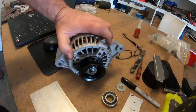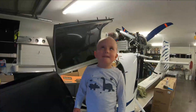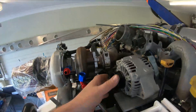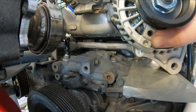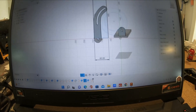We're going to build this alternator — 70 amp — going to mount it to the engine just like this. That's not how you do it — whoa, pull it back. Okay, so this is a Denso type alternator going onto this plate here. I'm going to mount the plate, which I've mounted to the engine. This hole here is the lower bolt hole for the adjuster, and that's the top hole for the adjuster, so it should go something like that.